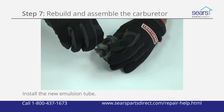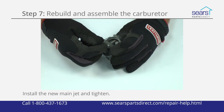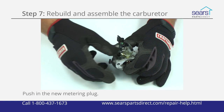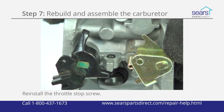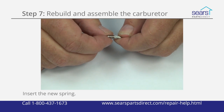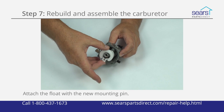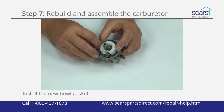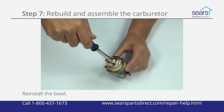Place the new emulsion tube in the central column with the flat end facing the carburetor bowl. Reinstall the new main jet in the central column and tighten it. Push in the new metering plug until it's fully seated. Reinstall the throttle stop screw, threading it in until it protrudes out the other side about 1/16th of an inch. Insert the new spring on the new float valve and snap the new float valve into the new float. Attach the new float to the carburetor using the new mounting pin. Place the new bowl gasket in the channel on the carburetor body. Reinstall the bowl on the carburetor using the mounting nut and tighten the bowl nut firmly.